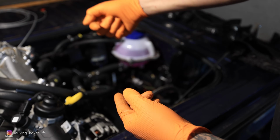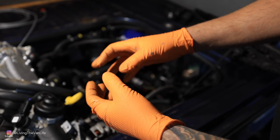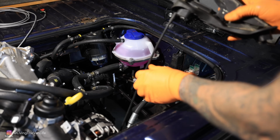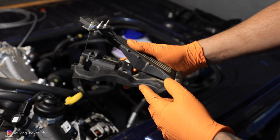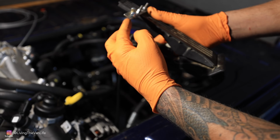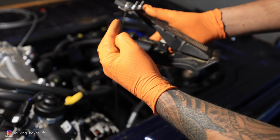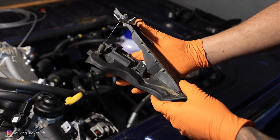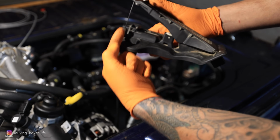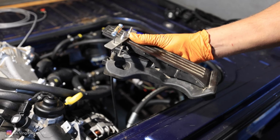From that kick down lever, there is a cable that runs back to the cable-driven throttle body in the stock Vanagon. So what we had to do is figure out a way to work in the drive-by-wire pedal into the equation. Where this would normally hook up to the actual cable-driven throttle body on the old motor, we took that cable and hooked it in line here with the drive-by-wire pedal, so that now when we activate the gas pedal in the front, that's going to pull this lever down just as if we were pushing the gas pedal.